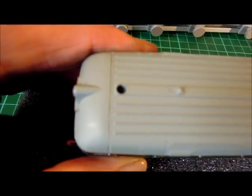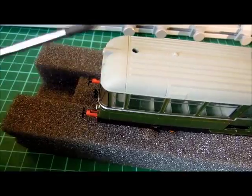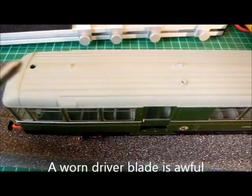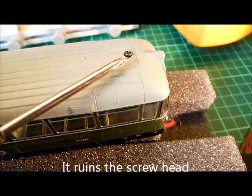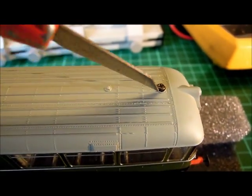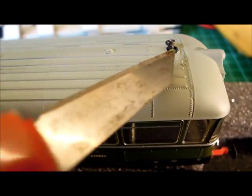I managed to get one screw right out. The screwdriver loosened one screw but didn't loosen the other one, and you can see the end of it is slightly worn, so I had to use a different screwdriver. It's difficult to know when the screws are out properly - they're machine screws, not self-tapping, and probably going into plastic. As you're turning, if you're pushing hard to keep the end of the screwdriver in the screw, it's possible the thread is just turning in its socket.